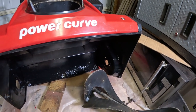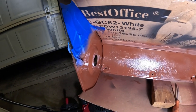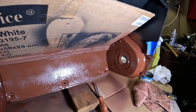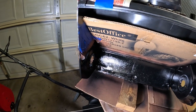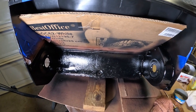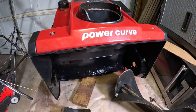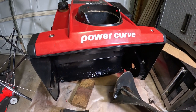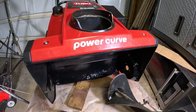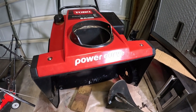I've been painting here and there — I painted the inside probably about four days ago. My videos take a while to make because I let the paint cure for a number of weeks before I start putting it back together. If you start reassembling too soon, the parts are going to fuse to each other and tear the paint off. The weather's getting colder, so it's harder to paint.